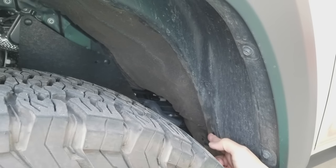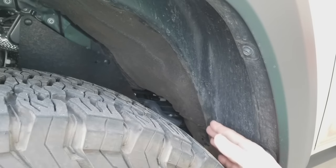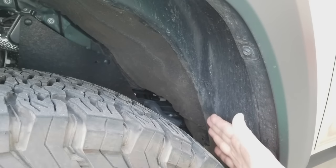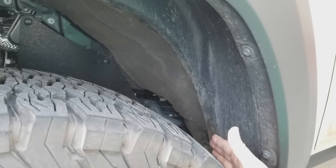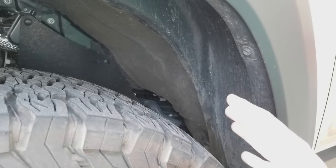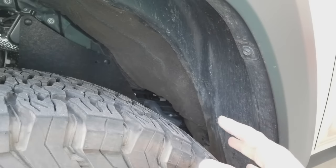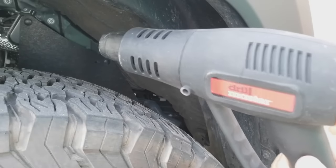So what I need to do is massage this area to kind of have better clearance. Unfortunately right here, I believe there's a pinch weld behind this. So what some people will do if you're getting extensive rubbing — you're going to have to remove this fender liner and bang it out or trim it with a saw or something. But I'm not going to go that far because I don't think there's that serious of a rub issue. I'm not running a 285 tire. If I was running a 285 tire, especially with stock height, it definitely would be an issue. Just trust the old heat gun I got from Harbor Freight.